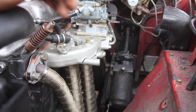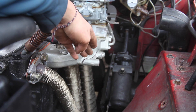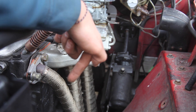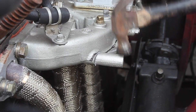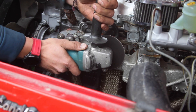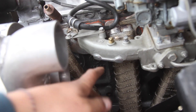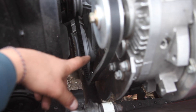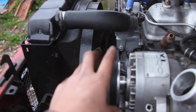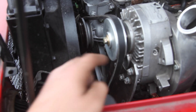I'm going to go ahead and cut off these two mounts that are on the intake because they're going to be in the way of the air cleaner on the supercharger. I'll cut them off, smooth them out, and then we can mount the supercharger onto its bracket. Now that I have those two mounts cut off, I went ahead and put the supercharger in — it bolts perfectly to the smog pump mount. Right now I'm tapping it with a hammer back and forth to get the belt alignment perfect, then I'll take it back out and weld that tube to the bracket.